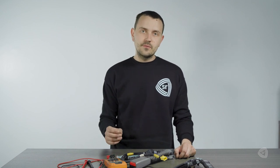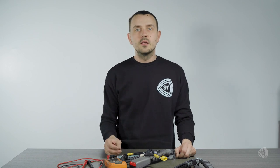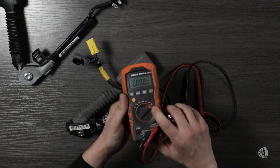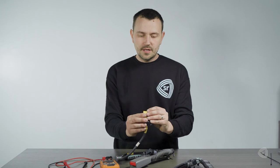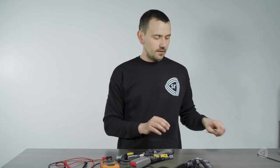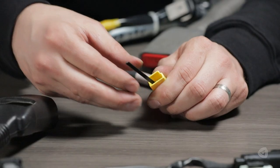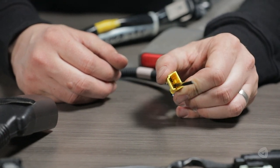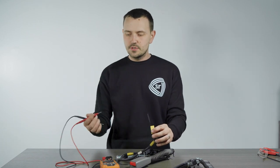A reading of two to three ohms is what you need for your airbag light to go away and any DTC codes to also be gone. To properly test resistance, start with a multimeter turned on to audible resistance testing. With these types of connectors, because they have a shorting bar pressing the two pins, I recommend grabbing a zip tie — you likely have one at home — and placing the pointed end in between just one of the pins. That's all you need to get a proper reading, because otherwise it shorts and you won't get a correct reading.